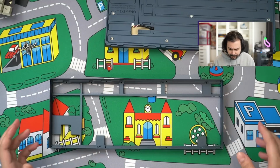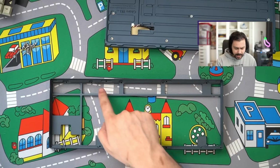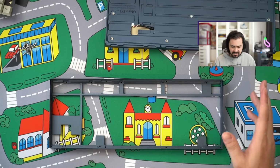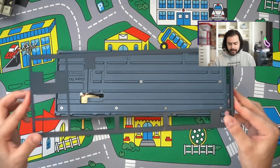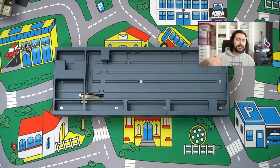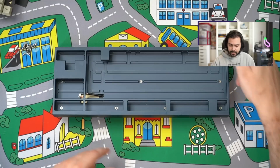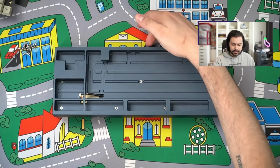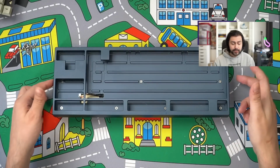All right, so the top is fairly simple. We can see where the plate mounts. We'll talk about the plate mounting itself later. And we can see where the case itself mounts. Looks like it does a relatively good job. Now, in terms of the top-bottom assembly, we saw all those machining waves that replace alignment pillars or alignment tabs. So let's see how much movement we have. That's actually very good. There's a little bit of top-bottom movement, or front-back movement, but very little left-to-right movement.